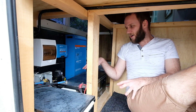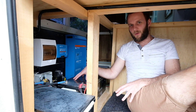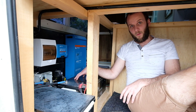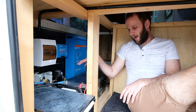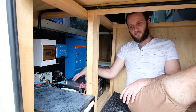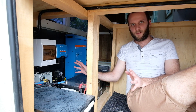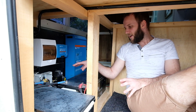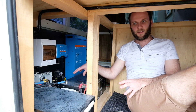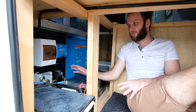So I thought we'd start with the batteries first. They're 12 volt, 200 amp hour lithium batteries. One of the limits to these is a max current draw. These ones are 70 amps, so together you get 24 volts at 70 amps, which is about 1600 watts. Which is enough for us, but it's definitely something to be aware of. Some are only 50, some are 100. If you want to go down this route, it's definitely something you've got to be mindful of.